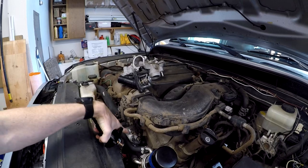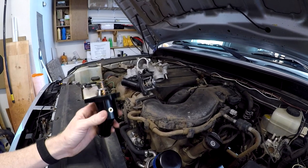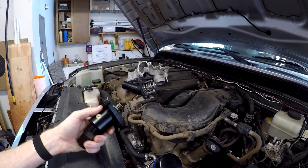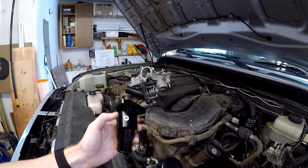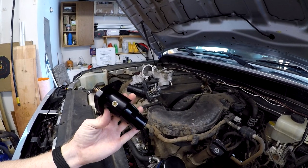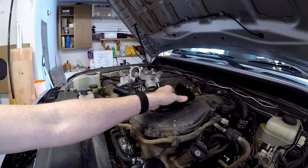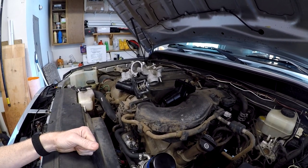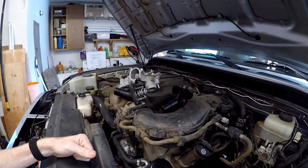You may need to remove that bracket for the sensor. I really like that this has the option for me to put a coolant pressure sensor in — that way I can monitor coolant pressure and make sure everything's okay when I'm off-roading out in the desert. If the coolant pressure ever drops while I'm off-roading, I'll know the coolant level is dropping, which could potentially save your engine. The cooling system hoses and everything can only handle so much — you slam your radiator into a rock and you kind of want to know.